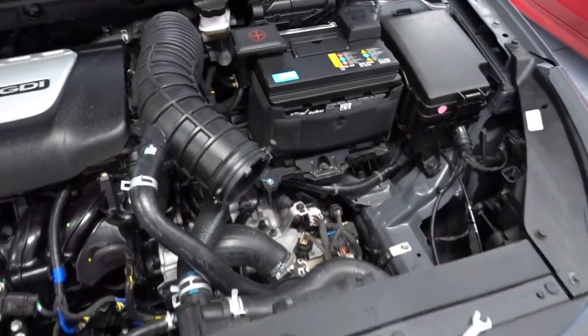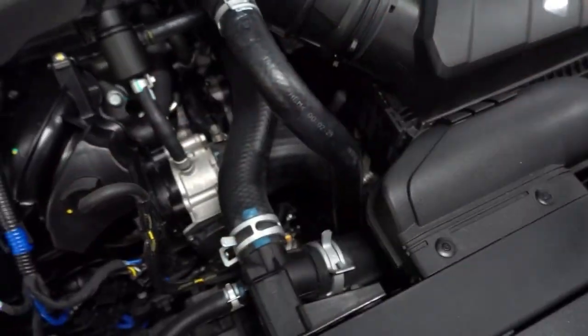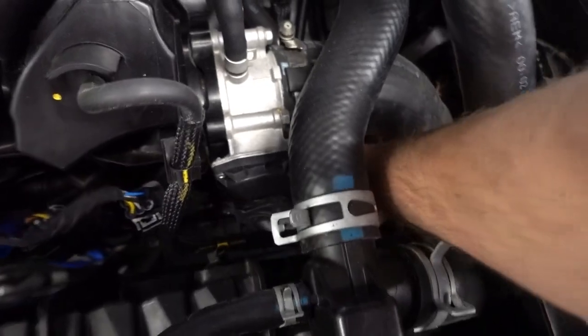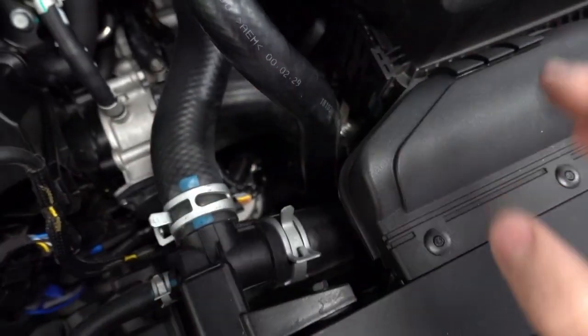The valve is now installed. I definitely recommend doing this from the bottom because it gives you more leverage for tightening those hex bolts. I just need to put the recirc port back on and assemble all the intake stuff. One nice thing I noticed is I can actually adjust this valve without taking anything else apart — if you have small hands and can reach down in there, you can twist the valve and adjust the bias for venting. Obviously you wouldn't want to do this while the engine's hot, but after it's cooled down or sitting overnight you can definitely adjust it. As for difficulty, it's not that difficult — just time consuming due to the tight confined space. I would definitely recommend dropping the shield below so you have access to the allen key when installing the GFB valve or loosening the bolts on the stock BPV.